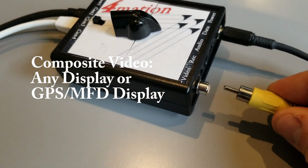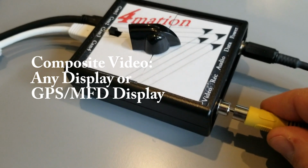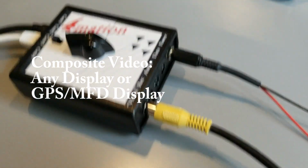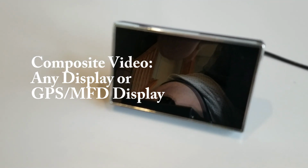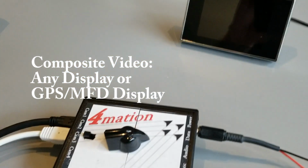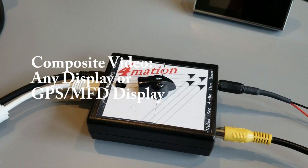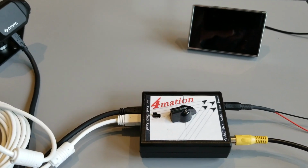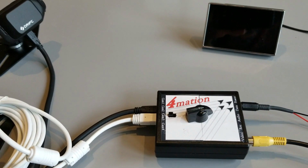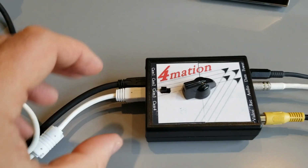And then the video port is just a composite video. The cool thing about that is you can plug it into a display such as this one that we bought for about $30, or if you have a nav EFIS display or any kind of an MFD in your panel, most of them have a composite video input, so you can have all of your cameras tied into your display.